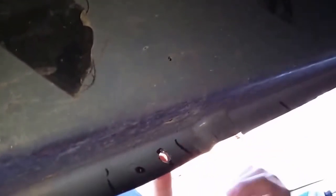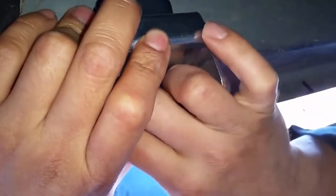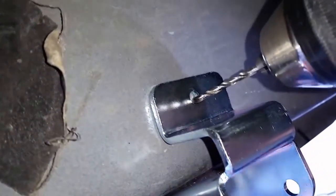I have drilled my hole out with a pilot hole using the 1/8-inch drill bit, then opened it up to a 5/16-inch hole. Now look at your bracket and drill through. Then using your 1/8-inch drill bit again, once you have tightened the bracket all the way, use the hole up here as your pilot or guide to put an 1/8-inch hole in there. This is going to be for your sheet metal screw.